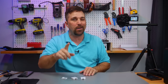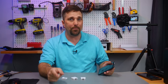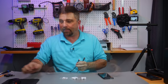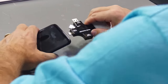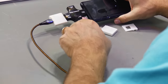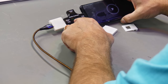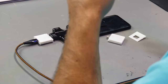I just need to plug them in and see if they work. However, I'm going to test the MagSafe charger on this phone first because I'm not crazy — I have no intention of blowing up my new laptop. So I have my USB-C to magnetic cable plugged in, a USB tester in line, MagSafe into the phone — and I got somewhere between 4.6 and 4.8 volts at 1.3 amps for 6.32 watts of power, and the phone is charging.